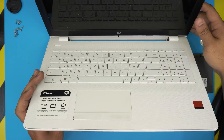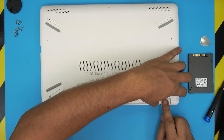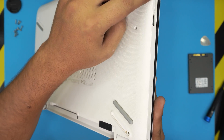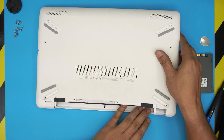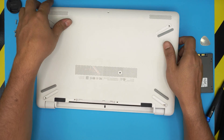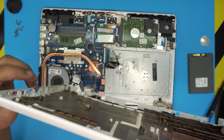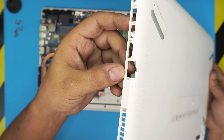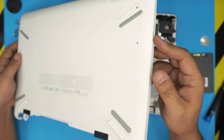Once the pick is in, close the laptop down. Grab it from the side that only has one USB port and the SD card reader, and lift it up. Wiggle it around — there's a clip in the middle so you'll need to pull up a little harder. We lift from the SD card side so we don't risk breaking the clips on the other side.